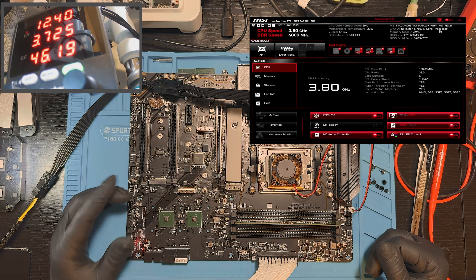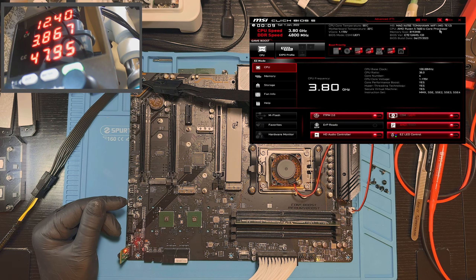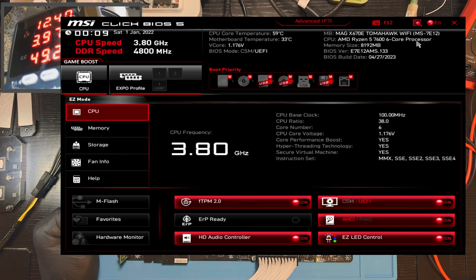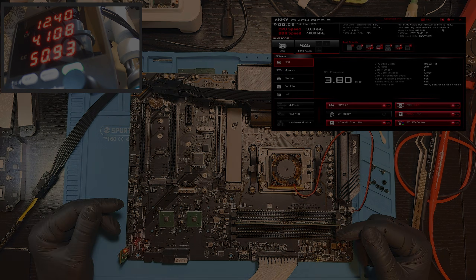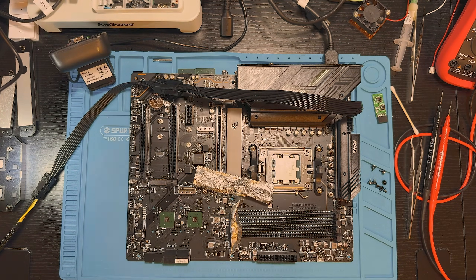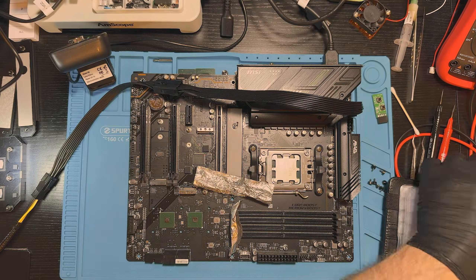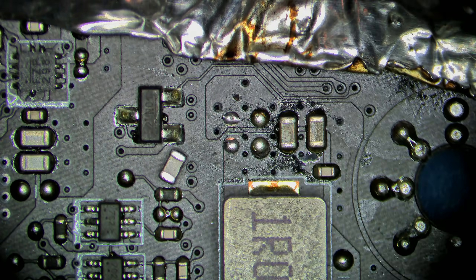So that's an easy repair, but we still need to place a good capacitor there for filtering purposes. The BIOS is from 2023, so we'll need to update it — it's quite outdated. Let's solder in the capacitor. Whoever says filtering capacitors are optional and that the board will work fine with only one — I strongly disagree. If they were truly optional, manufacturers wouldn't spend extra money placing them on the board. From my experience, missing capacitors can lead to instability and random reboots, especially under load, as some power regulators are very sensitive and can de-assert the power good signal when there are large fluctuations on the input power rail.